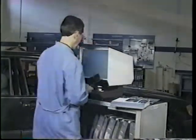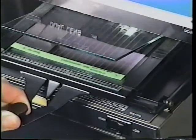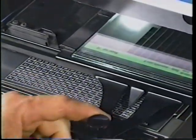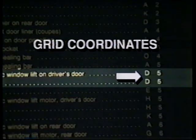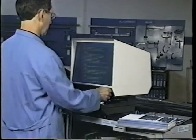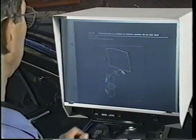If you've only used printed manuals before and haven't used a reader, it's simple. The fiche is turned so that the color band faces you, and it's placed on the carrier. The index of jobs is located at the right front of the grid. Move the pointer to that location, find removal and installation of the regulator, and the grid coordinates are listed in the column on the right. Move the pointer to these coordinates, and you're ready to start the job. That's an example of finding a repair job in the service microfiche. The example used required a model identification, since the job involved a repair on a body component, replacing a window regulator. But if an engine repair is involved, the model identification doesn't apply — that's because the same engine may be used in several different models.